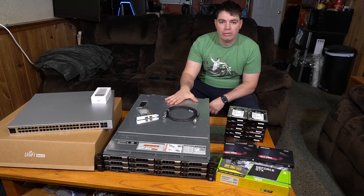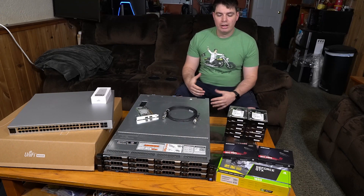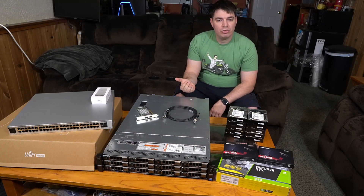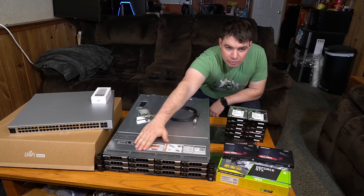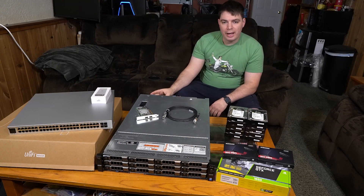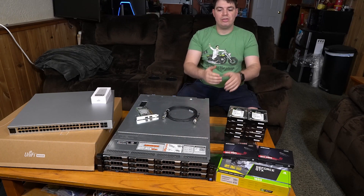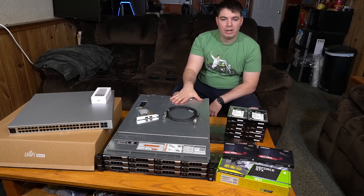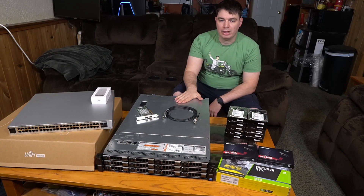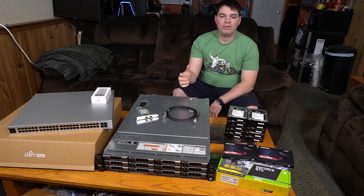What we're working with here is a Dell R730XD. Normally it'd be just a Dell 730 and you'd have about six three-and-a-half-inch drives in it. But this is an XD version, so we have 12, which fills up the entire front of the chassis. On the back, we actually have two two-and-a-half-inch drives right above the power supply — that's going to give us a great storage medium for our SSDs. This server has dual 10-core Xeon processors, 64 gigs of RAM, and it's going to be able to drive around 30 cameras. We're running Windows and Blue Iris, which is the NVR software we'll use to capture all the video from the cameras.